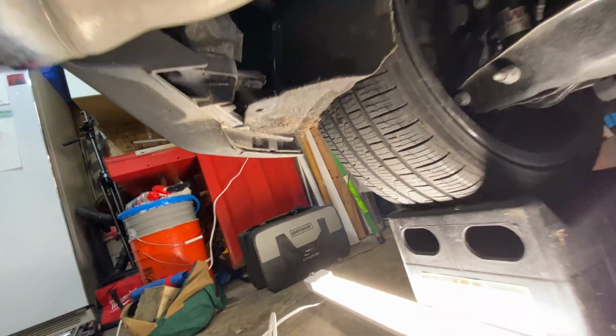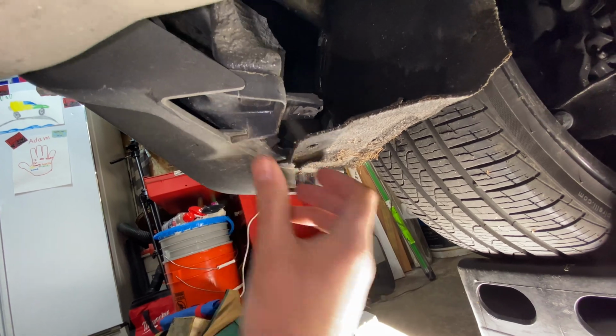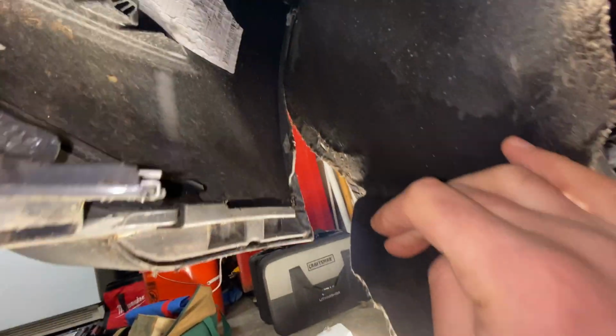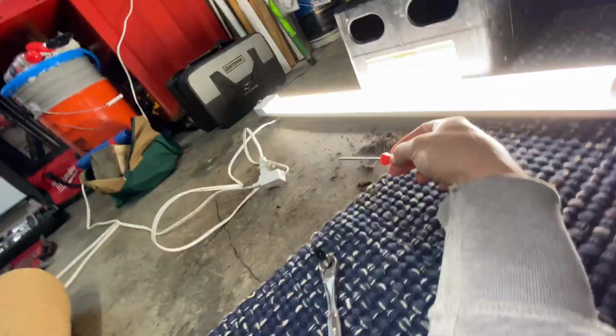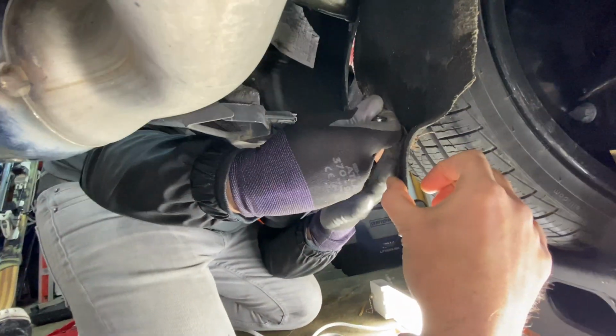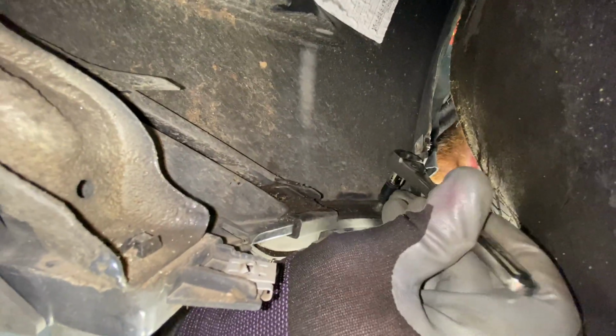All right, so the next step after you remove those 3 screws is to remove 2 more. You're gonna pull back the liner, and they are in the top side of this piece here. Ours are kind of filled with junk, so we're just taking something like a little metal pick and getting the heads kind of cleaned out enough to be able to get a T25 in there. Yes, contort your hand as best you can to get it up in there, and you're probably being able to see this like full on me being able to not land this in the hole.